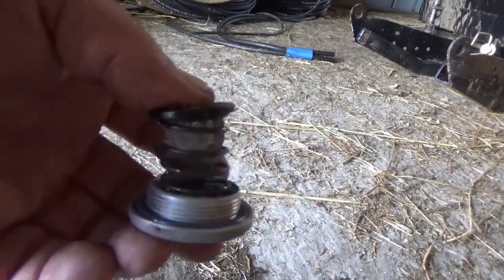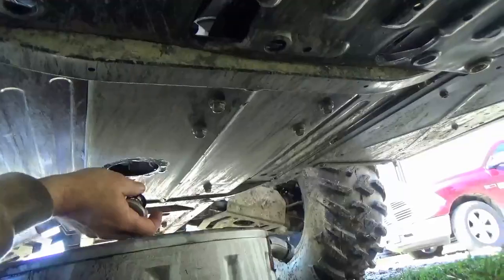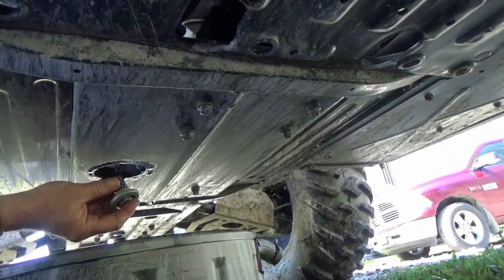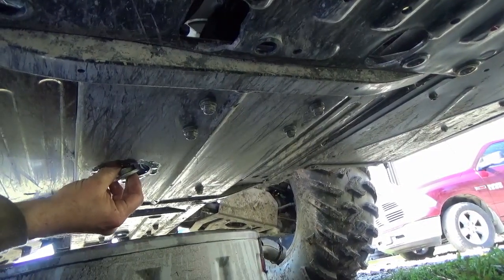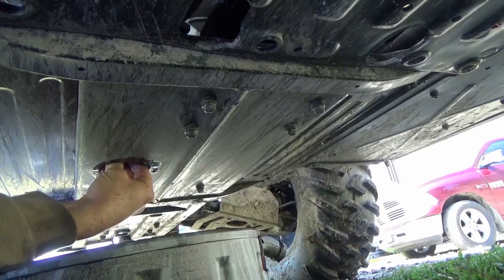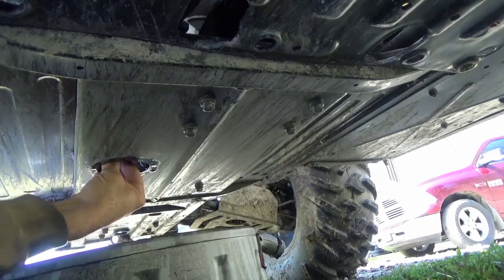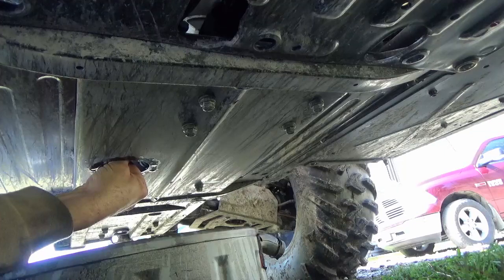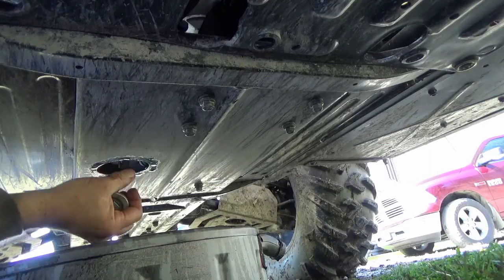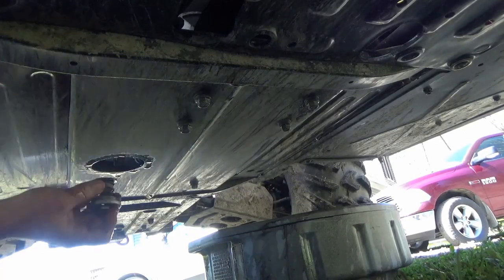I should mention too that I'm going to put a little bit of oil on the rubber O-ring that is on the drain plug. Everything's dried up and the O-ring is lubed, so now we're going to put this back together. Since it's spring-loaded it does take a little bit of effort to get the drain plug started. It feels like somebody's got their hand in there pushing back on you. I'm going to move my drain pan in case I drop it — I don't want to drop it in the bucket of dirty oil.